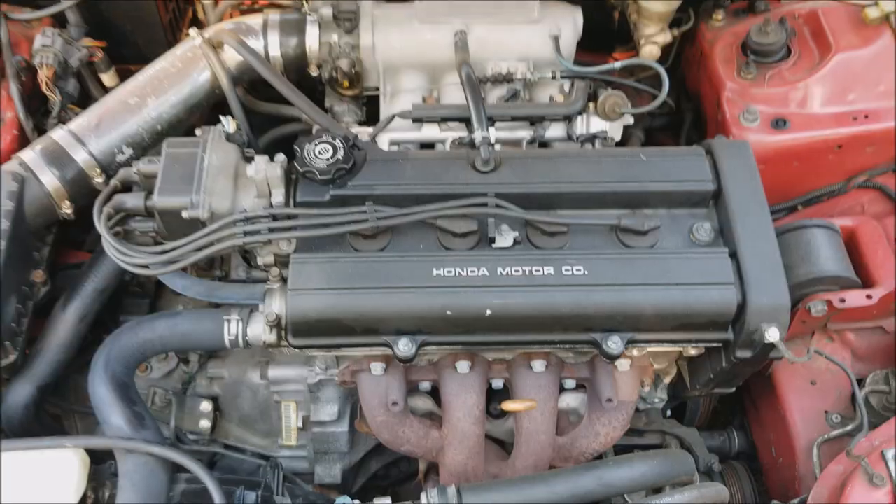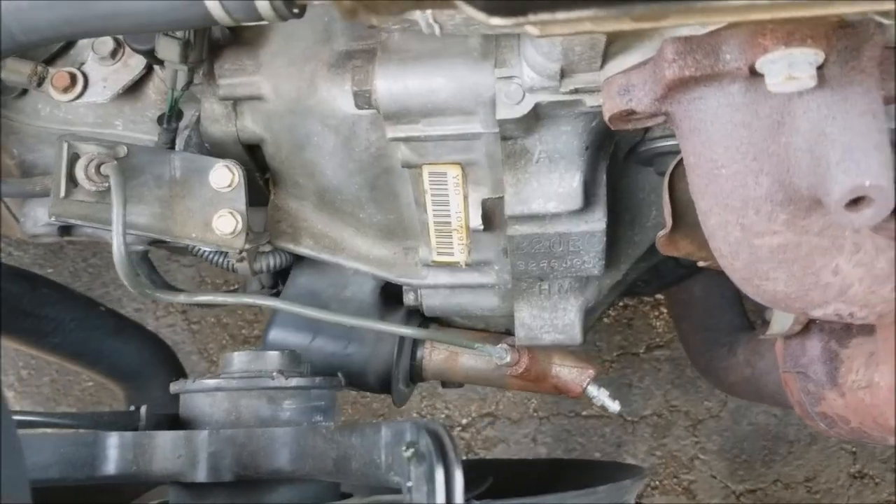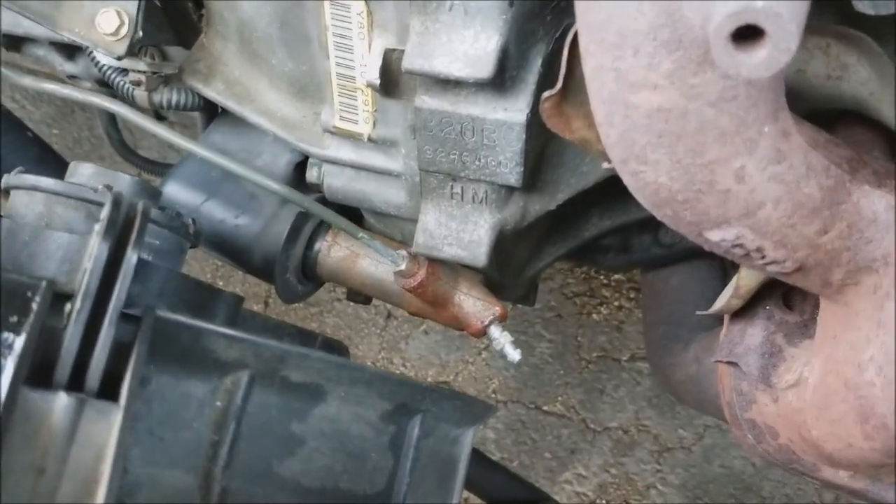You're also going to need a clear plastic or glass bottle. You're going to fill it about a quarter of the way with brake fluid, then put the line in there so that the bottom of the line is completely submerged within the fluid. That way, when you're pumping your clutch pedal and the fluid is going through the line, it'll go inside this container but no air will pump back in because the line is fully submerged in the fluid.